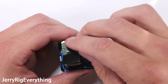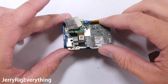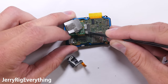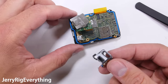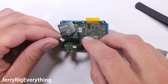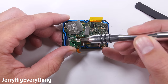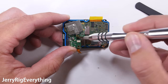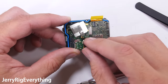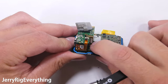Putting the lens back into place, there's a little Phillips head screw along the bottom. Then slide the motherboard in place, making sure to keep the LCD ribbon cable along the top before you pinch it down. Plug in the sensor ribbon cable, put the plastic housing for the charging port back into place, screw it in, and set the USB charging port into place as well. Take the two long screws and set those down, then plug in that little tiny ribbon — I checked for a latch and ended up breaking the plastic, but that doesn't break the connector, and since there's no latch you don't need to do it yourself.